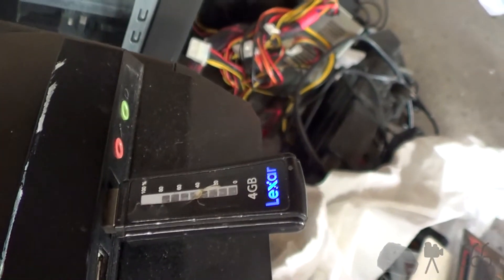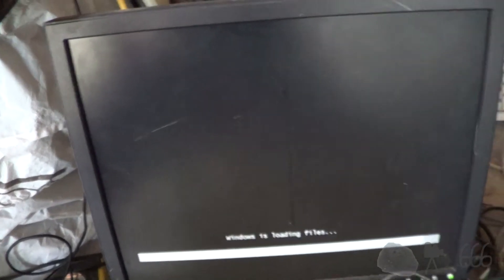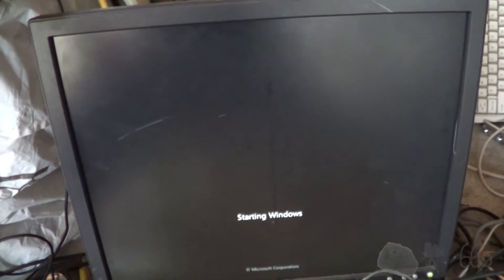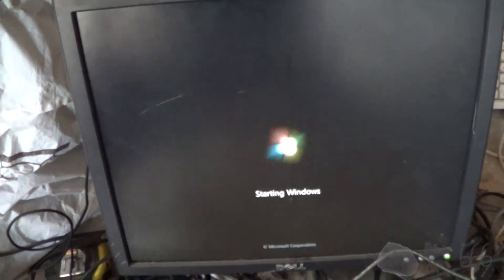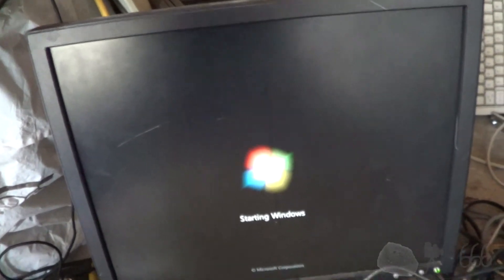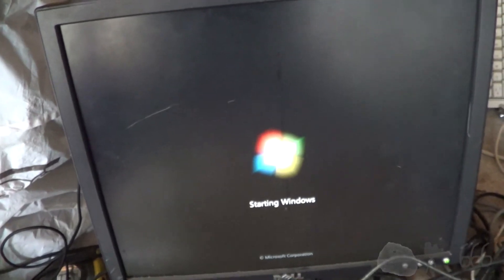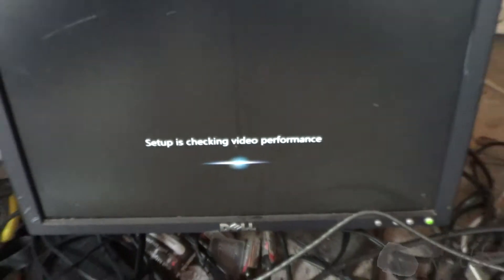I noticed that the key on the side of this computer is actually a Windows 7 Pro key, which I did not realize. Although there was originally a Windows 7 Home Premium key, so somebody spent a lot of money to upgrade this to a Windows 7 Pro license. If it were Windows 10 it wouldn't even have a license on the side — those go in the BIOS. This one might be in the BIOS too via SLIC, but it's the same basic idea.